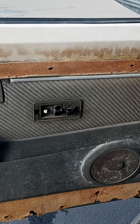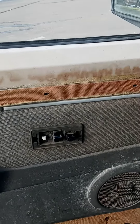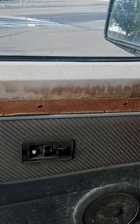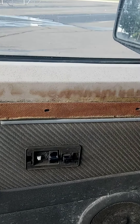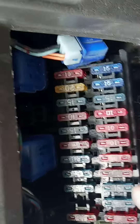This is the '86 Nissan D21 truck. I noticed the passenger power window went out. So I checked here in the fuses — you can see there's two blue fuses in there. Up here, these guys, that could be the problem, but in this case it wasn't. Or it could be these two blues, these 15's — and that was not it. It was not those.